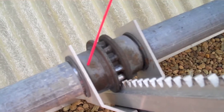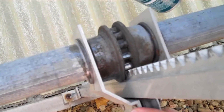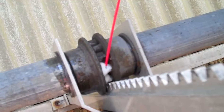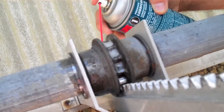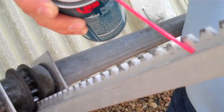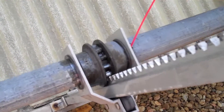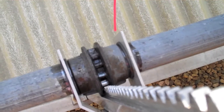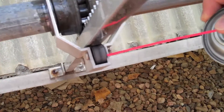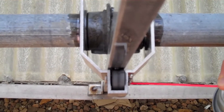So what I want to do is spray along the edge of that, and once again over here. It'll pretty much find its place. Then I'm going to come along the pinion gear and let it find its surface. It doesn't hurt to come along the side and just let gravity do its work. Then I'm going to repeat the same on the opposite bearing. It doesn't hurt to give a little squirt right in where the clevis pin is — that is the axle for the two rollers.